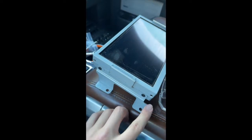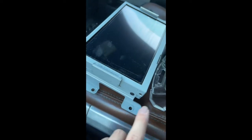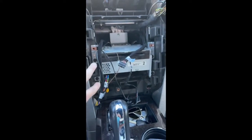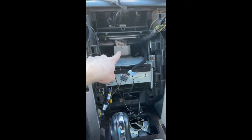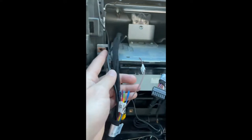I've got these two brackets secured back on with the T20 Torx screws. Make sure the one with only one hole is on the bottom — indicated by this little piece — and the notched side is on top. Same thing on the other side. I've got the CD player screwed back in with the two seven-millimeter bolts on both sides and the Phillips head in the back. The USB cable I tucked behind the CD player, looped it around, and tucked it down.